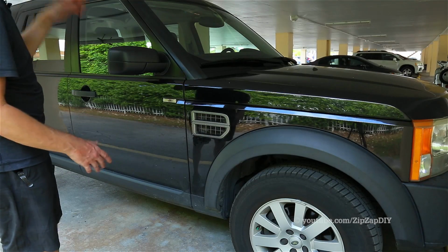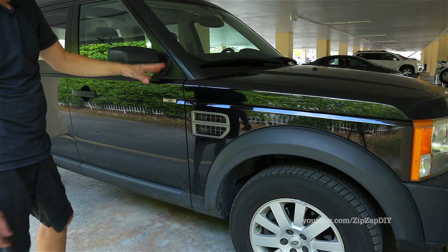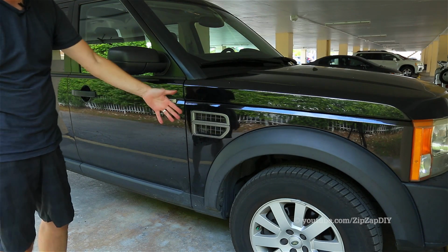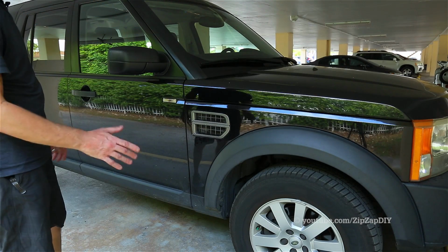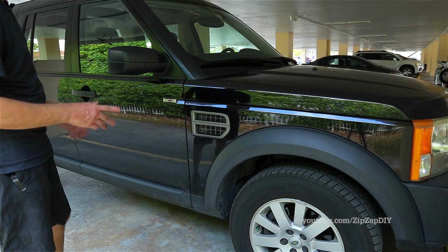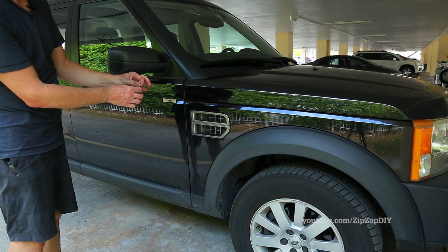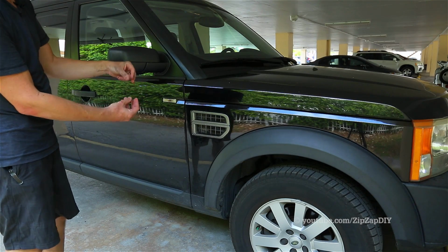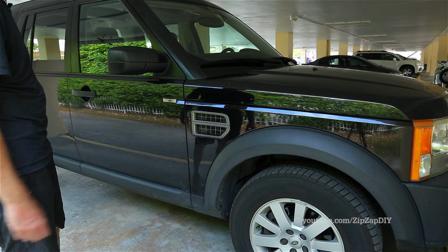Normally, to repair this, what you would do is pull down the headliner, remove the A-pillar covers, take out the glove box, some interior components, and the central junction box, and then replace the entire line. While that's a great idea, that's also a lot of work. What I'm going to do is do it a little bit differently. I'm going to cut the end of the existing tube off, and then splice on the end of a new tube with a 12 millimeter push to connect airline coupler.